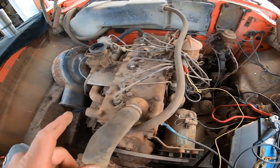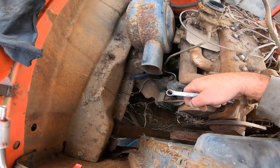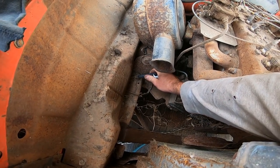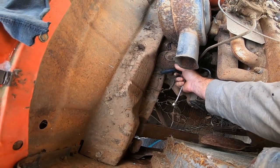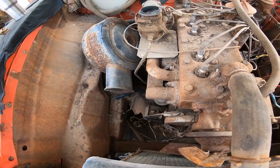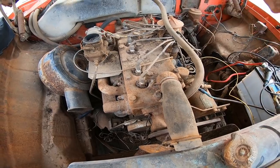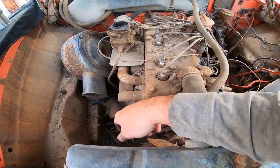Next is fuel. Speaking of rubber - look at this. Usually I like to cut the fuel line so that I don't pull up any of that old fuel, but I don't think there's any 52-year-old fuel in there. That's the rubber fuel hose - it's petrified. Usually I like to cut those off so it's not pulling old fuel and gumming up the carburetor or the fuel pump. Sometimes that old fuel will get actually into the valve guides and cause issues there - sticky lifters and whatnot. So I always cut that fuel line, but we're not going to this time though.